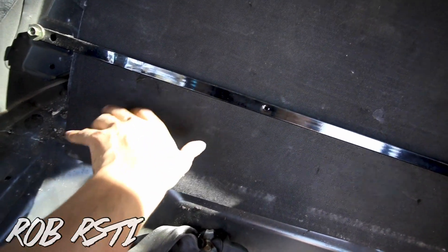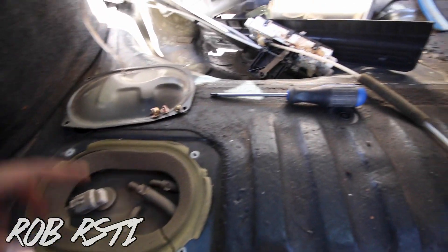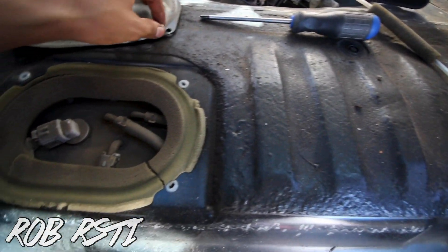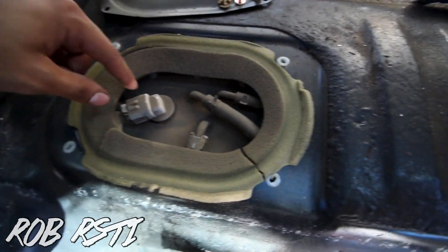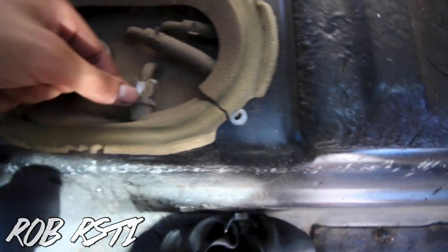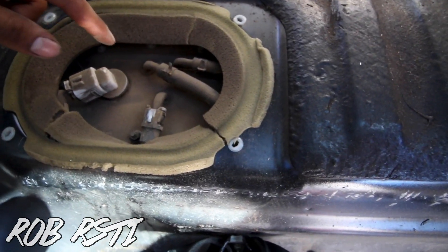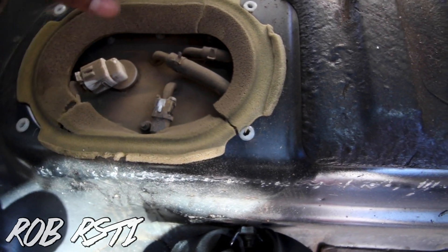The cap and the fuel pump will be right behind this panel once that is off. You're gonna see a cap with four screws — take them off and there is where the fuel pump is. I got a test disconnect here, and then these are your fuel lines. There's another connection here. Some fluid — gas — will come out, so just be aware of that; have a rag if you want.